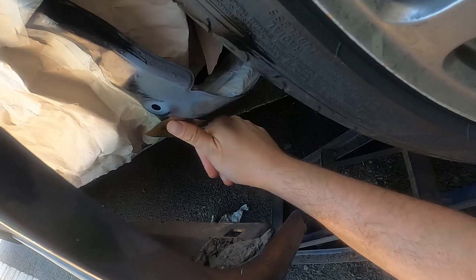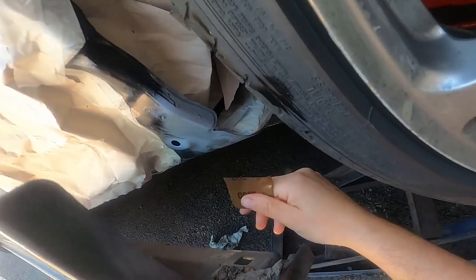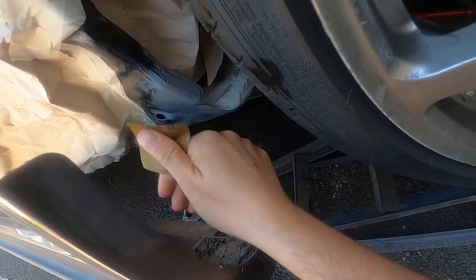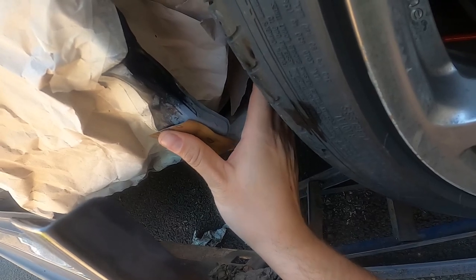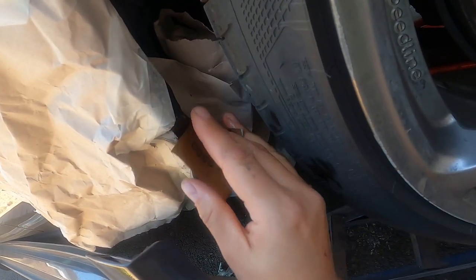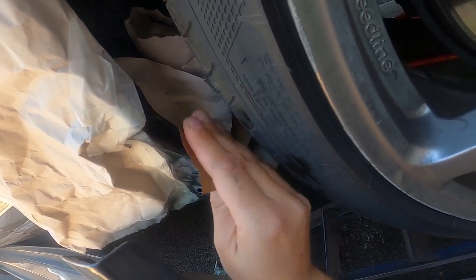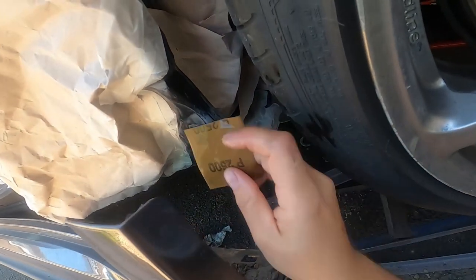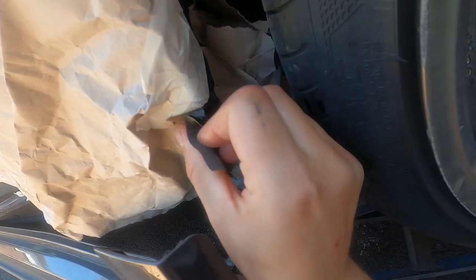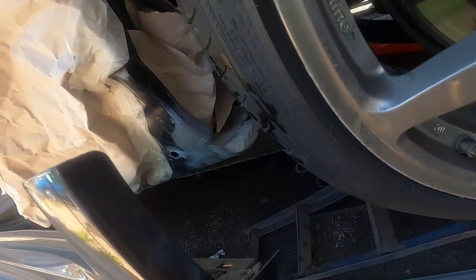I don't mind when I take a bit of the primer off because we know it's a bit of overspray on the normal paint. Normally you would use a block and all that kind of stuff but I don't need to - there are a lot of curves on this here. I'm not going in wild, I'm just making it a paintable surface, that's what we're doing. You could use something like a scotch brite. Definitely you want to be hitting this with isopropyl alcohol afterwards because all the grease from your hands is going to be going everywhere.